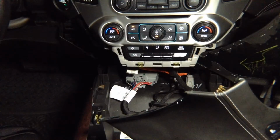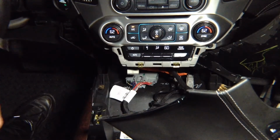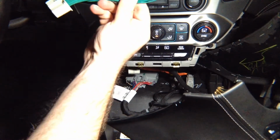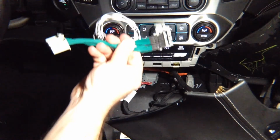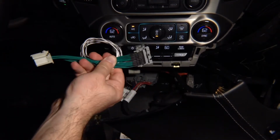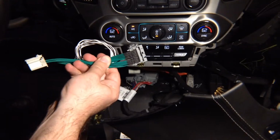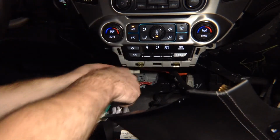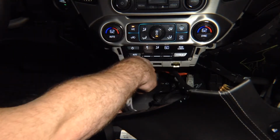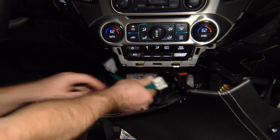So that's what we're going to be working with. You're going to see in the next slide the picture of the radio module, and it's identical in every car. Now that you have unplugged this wire, you take the supplied one. So that's your radio module. You just saw the picture of the radio module. This is where you're going to plug in this cable that we gave you. So you're going to plug in the supplied cable as follows. We're going to go ahead and plug in this. You plug in what you unplugged previously, and then you're going to plug this back into the radio module.